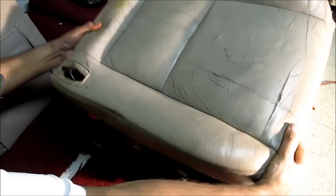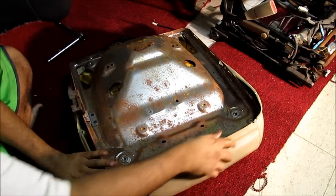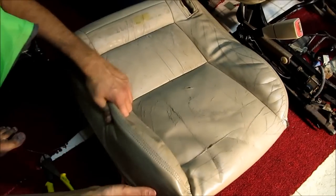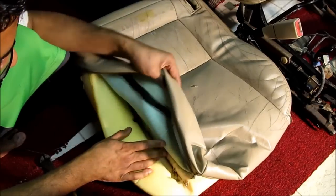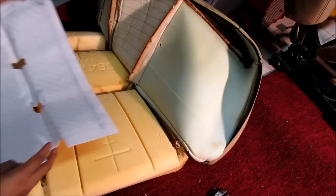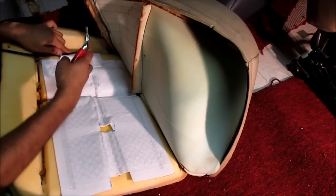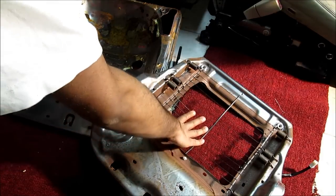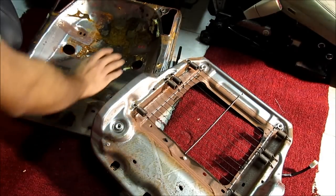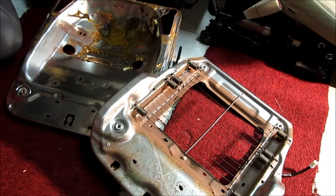Next I'm going to remove the pan from the leather bottom — I'll go around and undo the clips, then remove the pan. Here I've got the seat bottom. I'm going to pull back the leather and undo a few hog rings. Now that the leather cover is pulled back, I'm going to install the heater pad, then replace the hog rings. One difference between the Toyota seat and the Lexus seat is that the Toyota one uses springs, making it a bit stiffer, compared to the Lexus seat that fills the area with sponge, making it a lot more comfortable.